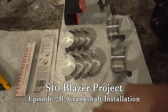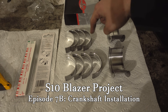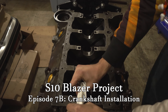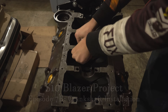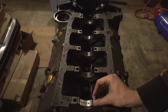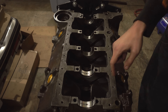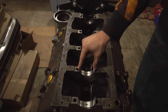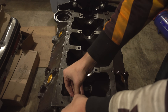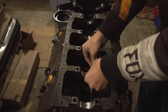We're finally breaking out the bearings and the plastigage. I already went through and wiped these all off with brake clean. On this particular engine all of the thinner bearings are the same size, but it is worth checking part numbers to make sure. We'll make sure all the saddles are clean and dry, and make sure you're using the slotted and drilled half of the bearing in the block so that it'll actually have oil flow to it. Some bearing sets use two slotted ones, and then you really can't go wrong. Line up the notch with the notch on the block, press it down, make sure the oil holes line up, and get it as even as you can.